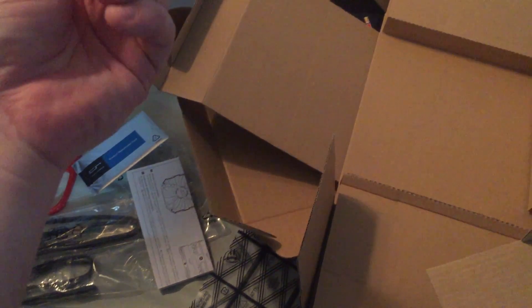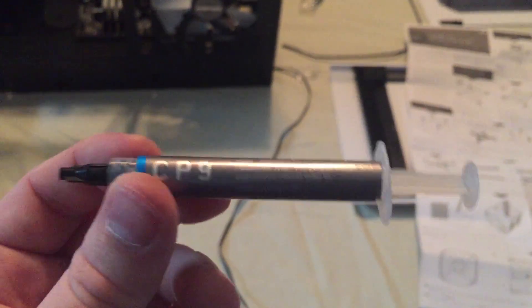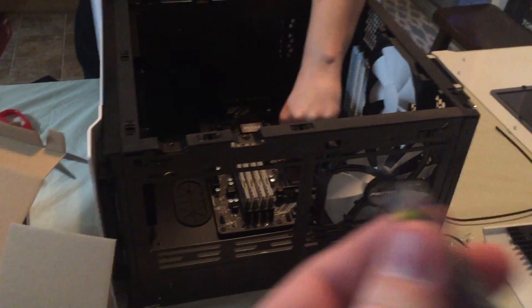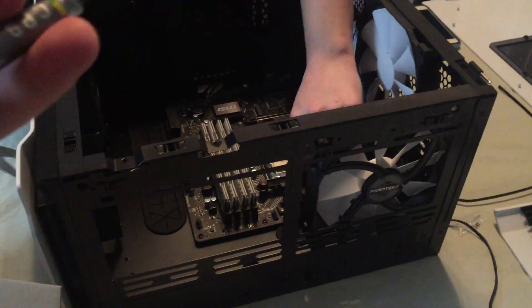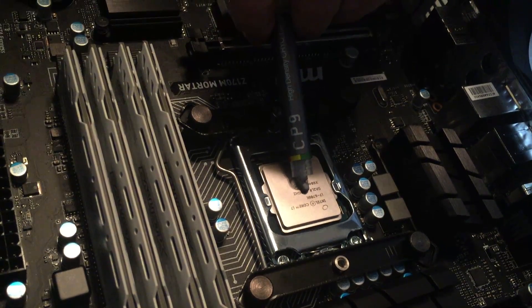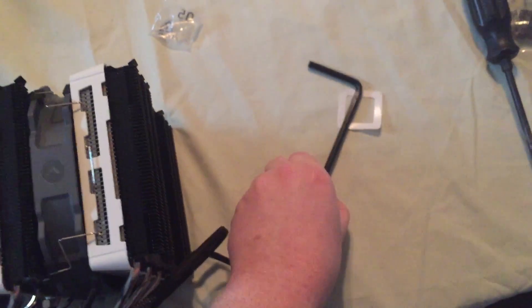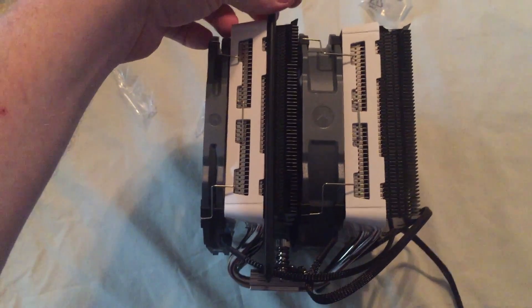The next thing you're going to need to do is get your fingerprints off the CPU. Now you need a little thermal paste — this is their special CP9. The way this works is the heat comes off the CPU and goes to the bottom of the cooler, so you use this putty in between so they make full contact. Get a pea-sized amount — perfect. We thought we were screwed because this is like our biggest screwdriver, but when you buy a premium product — boom, this is now my longest screwdriver. Try to get it as straight as you can because you don't want to move it around once it's on with the thermal paste.